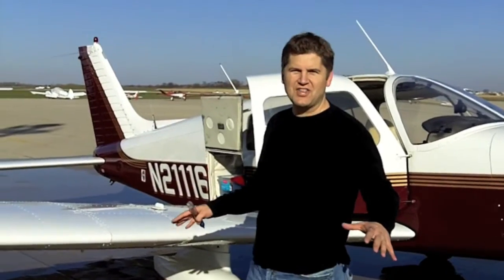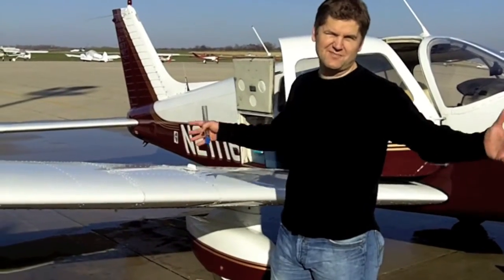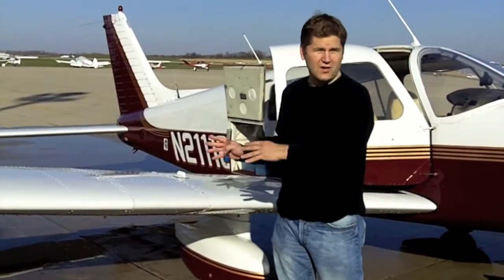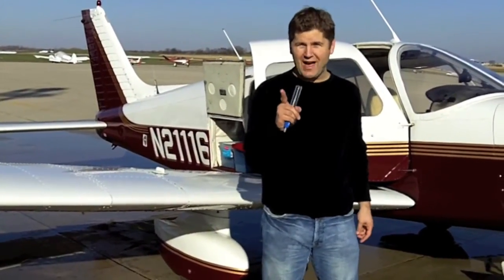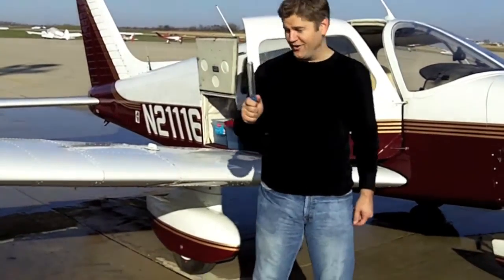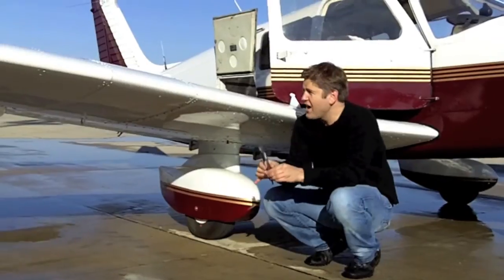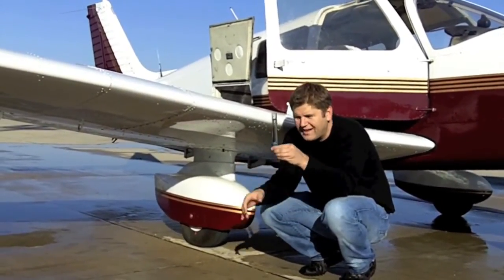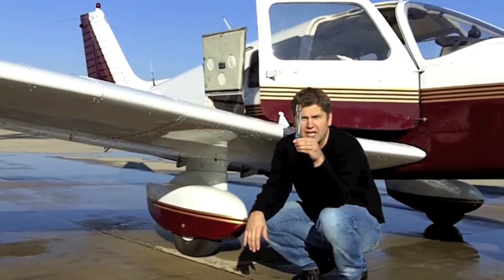Okay, we just finished washing the airplane — I'm talking loud because I'm not wearing the mic. And one thing you have to do, even though we pre-flighted the airplane and we're ready to go flying, there's one important step we have to do over again, and that's check the fuel for water. I'm checking to make sure that during the washing process of spraying the hose and washing the fuel cap area, none of the water got into the aircraft.